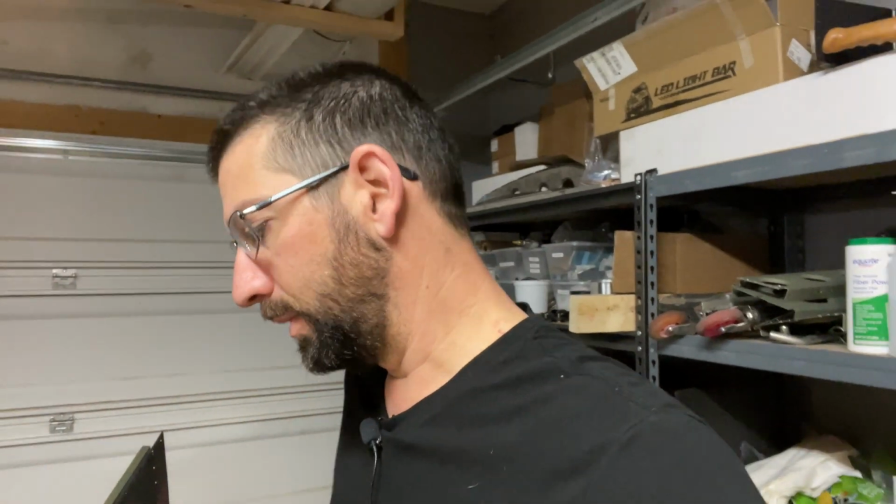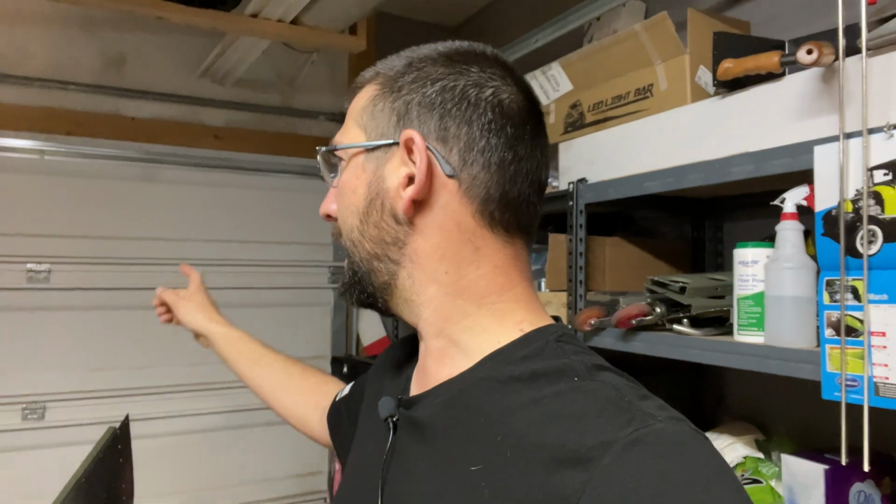in my garage. Now, there's an issue with putting an air conditioner in the garage, and that's usually the garage door. My garage door is not insulated for radiant heat. However, it is insulated for sound deadening, which is great, but it doesn't really help when it comes to the summer, or any time for that matter, when the sun is on the west side and my door faces the west. So what happens is we get a lot of radiant heat coming from that door, and I don't want to have that AC running non-stop, so I want to try to limit some of that radiant heat from getting into the garage. That way I can continue working into the summer comfortably on my Zenith Cruzer.